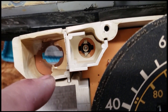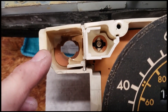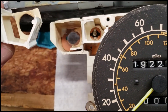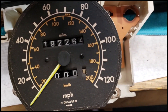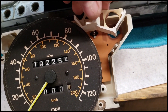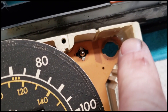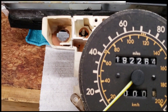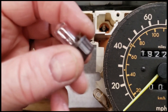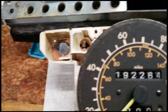You can see this plastic insert got so hot that part of it broke off or melted off. I think somebody has been into this instrument cluster before because I did not see that piece of plastic anywhere. It's supposed to look like this — the one that goes on the other side fits in there like that. I've got some plastic epoxy tucked in the corners and I want to let that sit for several hours to harden up.